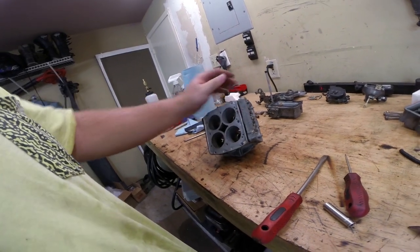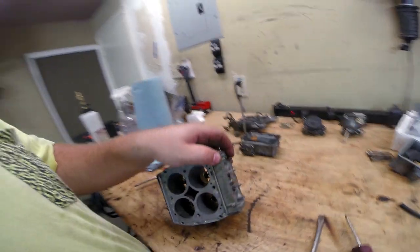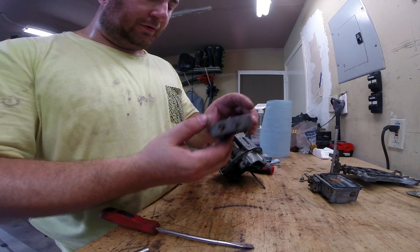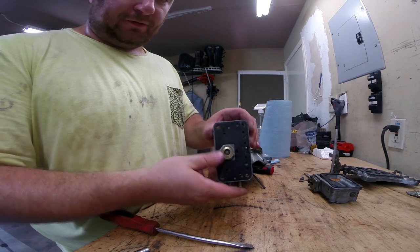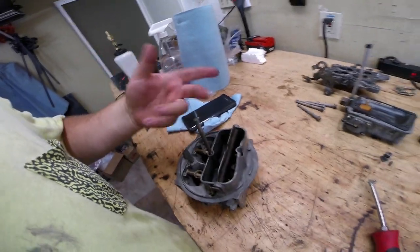This metering valve — mine was just stuck on there real tight, but a little screwdriver in here and you can get it to pry loose. And just like that, there's your metering block, there's your power valve. Finally these guys come out — they're just a set screw right down in there. You just undo it and flip everything over and that's what pops out.